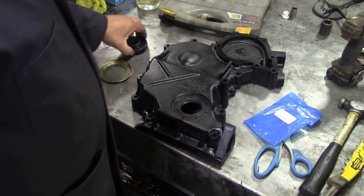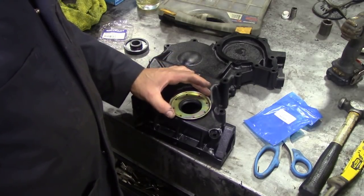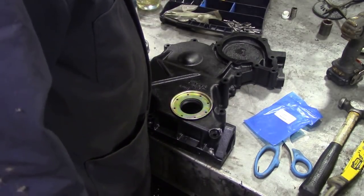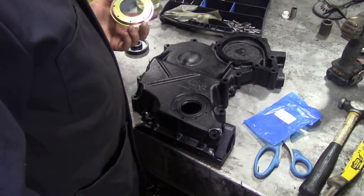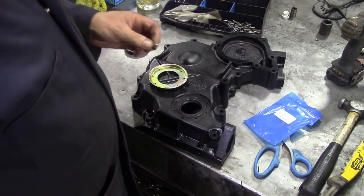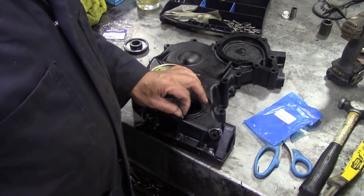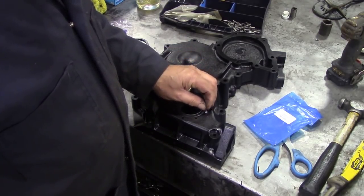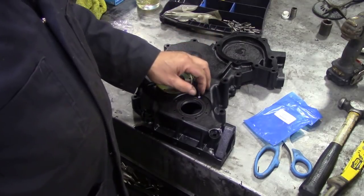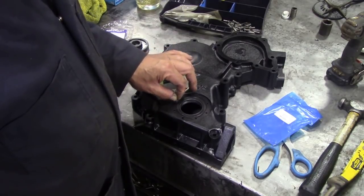It looks really good. So we'll put that back in the box, and now we're going to fit this sort of alleged dust shield. Now this in itself proves a problem because of the screw holes. So what I'm going to do, hopefully, is use some pop rivets to hold it in. It's not a structural part or anything like that, but I'm thinking that some of these holes are quite big, so I might have to put a different pop rivet in there. But for some of the holes, it's not a bad size, if you see what I mean. I think in the original rivet holes it would have held in really well, but some of them are not quite right, see?